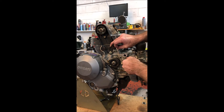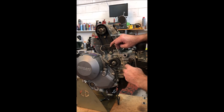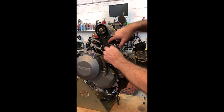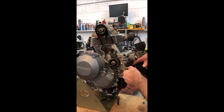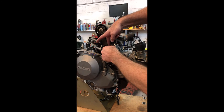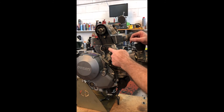If they're noisy — not overly rough but noisy — I'd replace both of these. I actually keep them in stock; I go through so many of them on these late engines for whatever reason. It's peculiar to these engines — the older traditional two-valve engines you very very rarely replace them. And just check the moving tensioner bearings too; that one's a bit noisy. I think I'd replace that one because of the noise it makes. These are 80-odd dollars each and the others are a hundred-and-something dollars each, so it gets expensive.